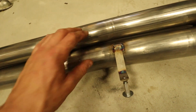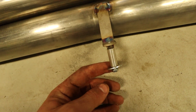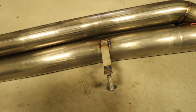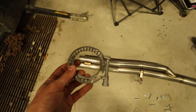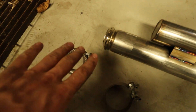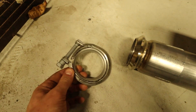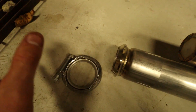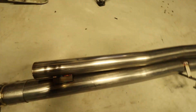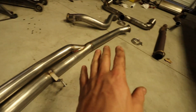For hanging this exhaust, it comes with two long screws, two shorter screws, a couple of aluminum spacers, and washers. It should sit with the spacer in the middle - hold it in place lining up with the hanger, put it through and tighten it up. That little washer will prevent the whole exhaust from slipping out or rattling around. I also recommend getting a new v-band for the down pipe - it was only about ten bucks and it means everything on the exhaust will be brand new.